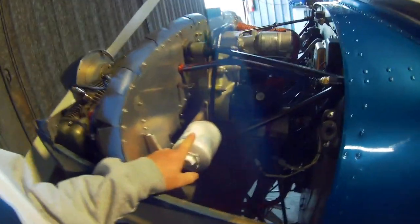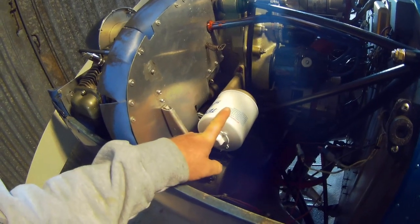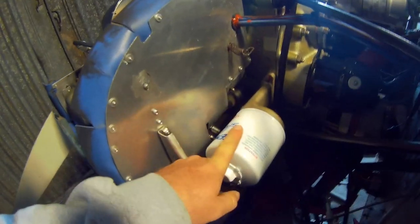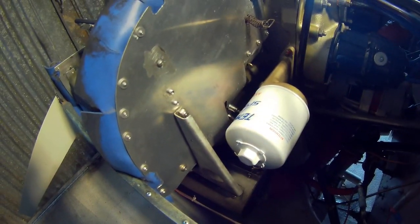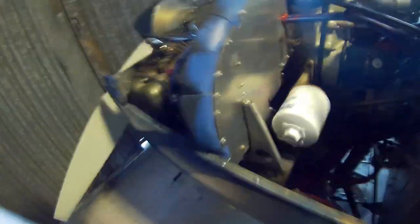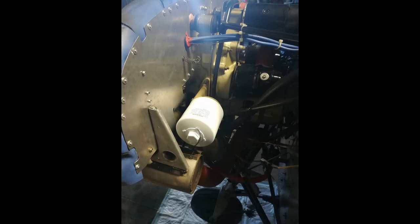This is way better than the stock screen — it filters better, takes way more contaminants out, it's a whole lot easier to use, it increases your oil capacity a little bit, and in the summer it helps keep your oil a little bit cooler. They even make little fin adapters to go around your oil filter to help cool your oil down. Way easier to safety wire too. Pretty simple little upgrade — shouldn't take more than a couple hours at best. I think I had the whole thing done in an hour; I spent more time on the paperwork than anything.